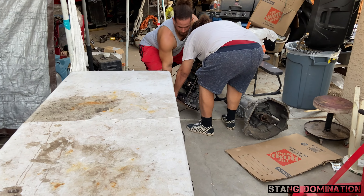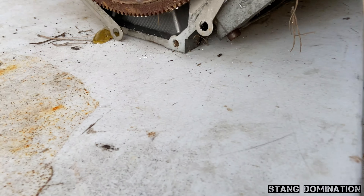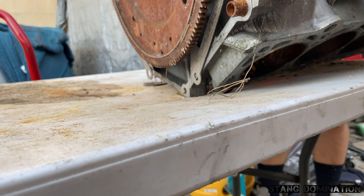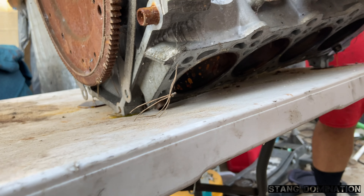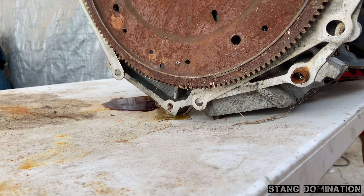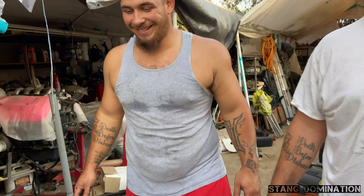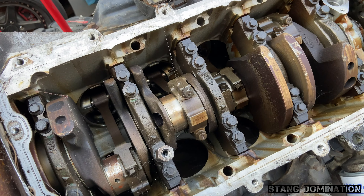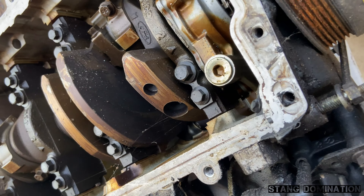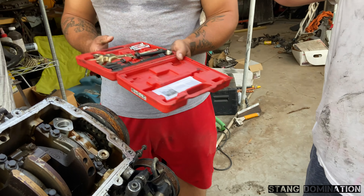Since we have everything crowded and we're doing like three different motors at once, they seem to think this engine is gonna be held up by this. Look — there's two rods gone. Did you see the timing cover too? That's cracked in half. We did that. You can take off the pulley — the bolt's gone, take off the balancer. But there's two of them missing. Maybe we did that though — we were the only ones that opened up the motor.